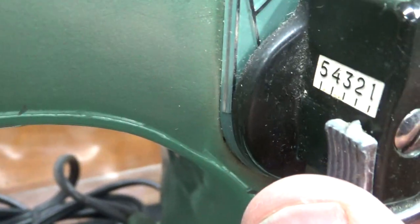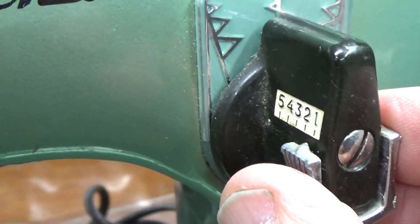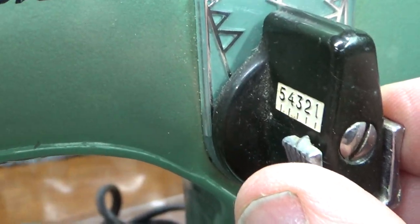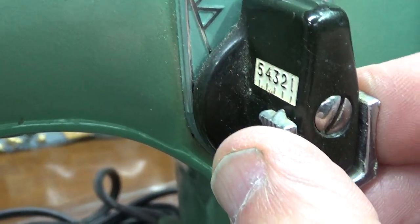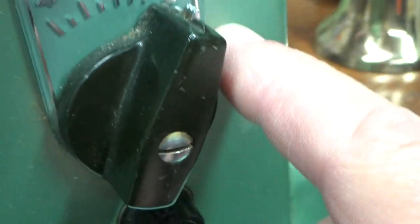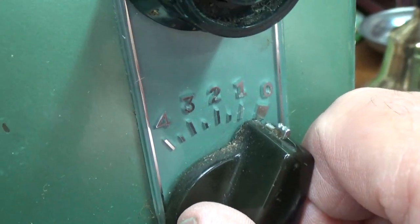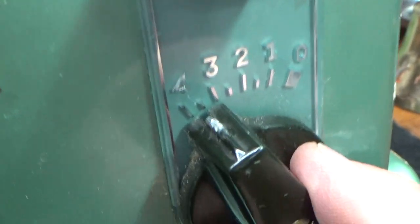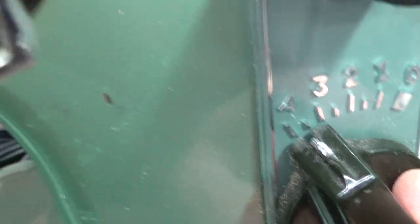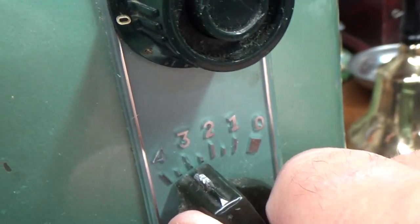In other words, if you sew a stitch in position 1 like it is right now, before you try to force this to go to position 2, and if you've tried it in the past and it's like, doggone it, it's jammed, what's going on? You may have to do a reset on your stitch width to release that mechanism. So if you're obviously going to be probably on 4 somewhere in that range when you're using one of these cam functions, then go all the way to 0.